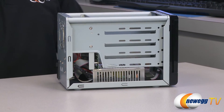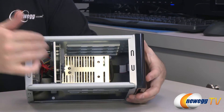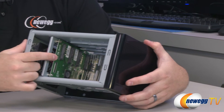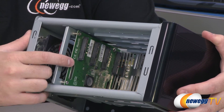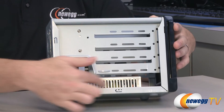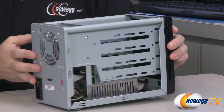After removing the thumb screws, the housing pops right off. Here's a look at the interior. There's a look from the top down at the drive base. You also have this backplane right here, and that is a Silicon Image 3726, which is your actual serial ATA port multiplier that all of the drives plug into. Also down here at the bottom is your power supply, and at the back, your 80 millimeter exhaust fan.